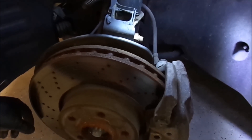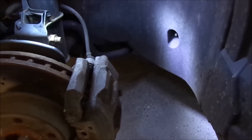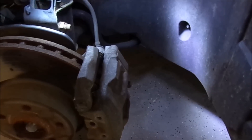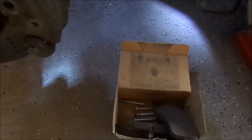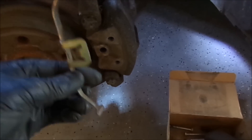Now I've got to the driver's side. What I noticed is that once you remove those 13mm bolts, I had reused them on the passenger side. But then I looked at the box — there are four new bolts included. If you buy the brakes from a dealer, they are included. I also didn't show on the passenger side how to install the clip back.